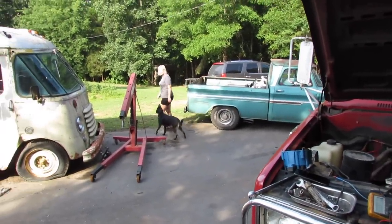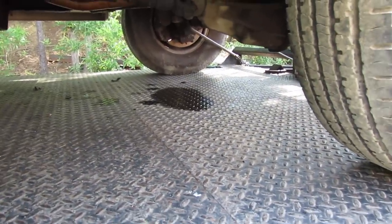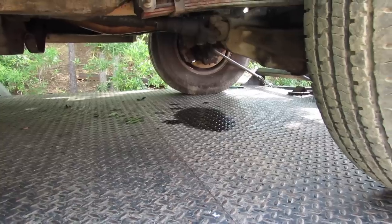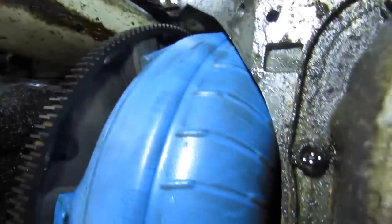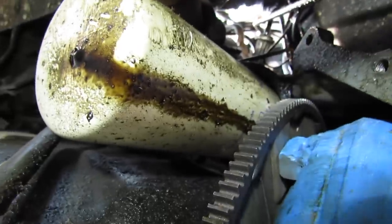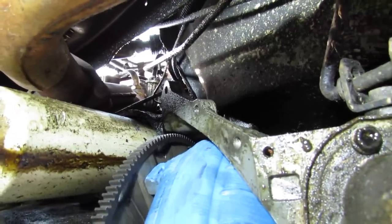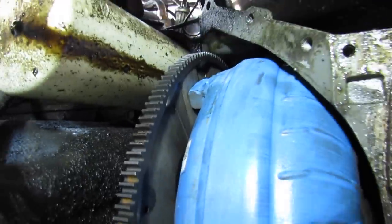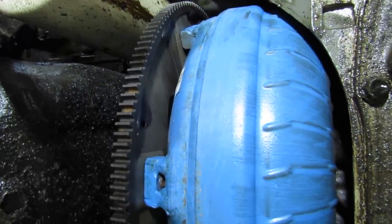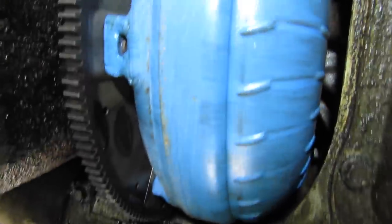Now under the truck here we've got a little pond and that's not good, so I'm gonna crawl up under there and see what's the matter. Well, the first thing you'd think is the rear main seal, but I don't know that it is. I think oil's coming from up high, like maybe a valve cover gasket — so that's good. Anyways, we had to take the inspection plate off because I was afraid the thing was seized. I couldn't get it to turn by hand or by the bolt, so I made him take this off and it turns.